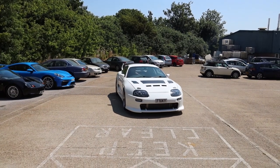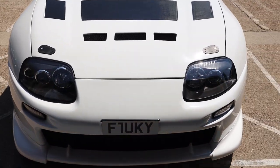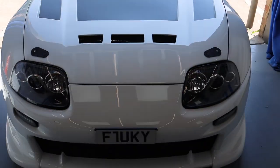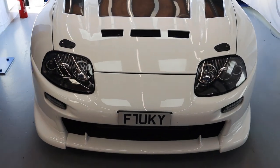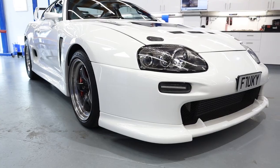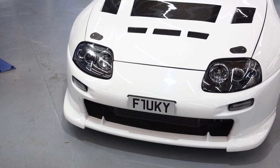So what we're gonna do, we're gonna drive it in now, and you'll be able to see that at the moment, out in the sun, this bonnet looks very, very good condition. The customer said all it needs is a polish. Then as we drove the car indoors, we could start to see the defects. When I say defects, I mean sinkage, and now it's really dull and matte, really poor texture to the finish. The problem is the sun does actually bleach out in lighter colours. You can't see the defects. Well, swirls being only one of the defects.